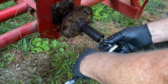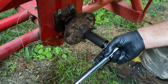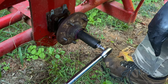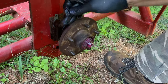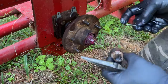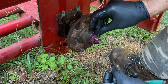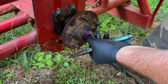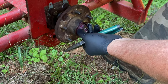So let's do it all legal on this trailer, Nathaniel - you want your trailer done to spec, right? Here we go. There we go, we're ready to go. With that hub bearing torqued down to proper spec, we have a new cotter pin, so we're going to stick our little locking ring on here. What you want to do is line it up with whichever hole you're going to stick your cotter pin through - we're going to go through that one right there - so move it around until it looks like it fits the best.